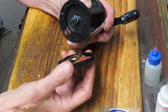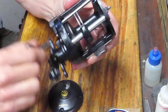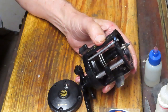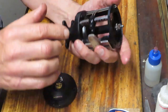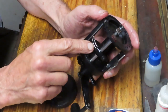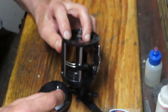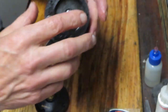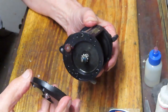When you find a reel that's hard to turn, make sure to check the gear side — the obvious culprit there is frozen, hardened grease, which we've seen on a lot of spinning reels, but that wasn't the case here. Remember to check your line guide too — it can have grease in the tracks slowing it down, a damaged pawl slowing it down, or even a bent line guide track that needs to align with the hole before the side plate goes back on. In this case none of those applied during diagnosis, so we had to go deeper — and there was only one place left to go, and that was the idler gear.